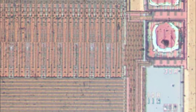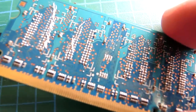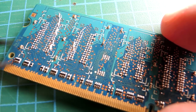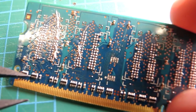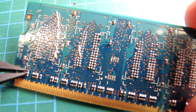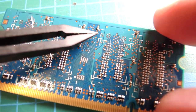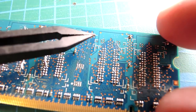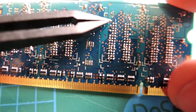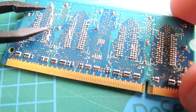Let's keep going and see what else we can find on a DRAM DIMM. Here's the shell of the circuit board now that the semiconductors have been removed. The other remaining components are series termination resistors — they enable signal integrity. Signals have to be driven in and out at extremely high speeds, and you need techniques to make sure the signal arrives in time and doesn't bounce back. Series termination resistors achieve that, and you often see them lined up on the edge of the connector. There are also capacitor locations that provide a local power supply for the DRAM, preventing voltage sag as the DRAM drives out current.